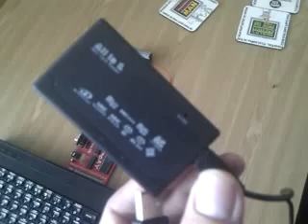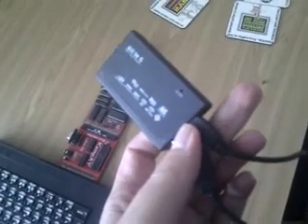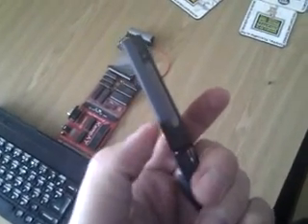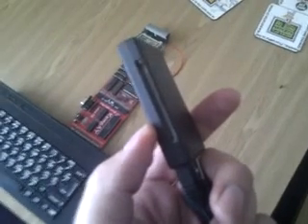It's just a simple case of using a card reader. This card reader reads various types of card: SD, XD, MicroSD, and Compact Flash. The Compact Flash slot is on the back. This can be bought on eBay for about 99p. Plug it into your PC, put your Compact Flash card in, and it pops up in Windows XP as a removable drive. The Compact Flash card is then formatted to FAT16 format. Once you've done that, you can copy your Spectrum emulator files onto the card via the card reader.